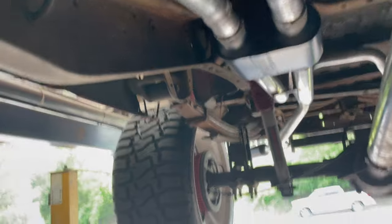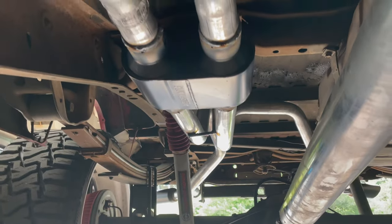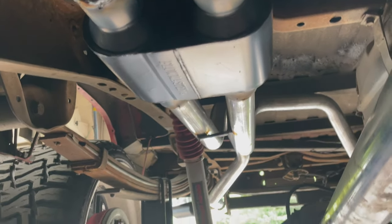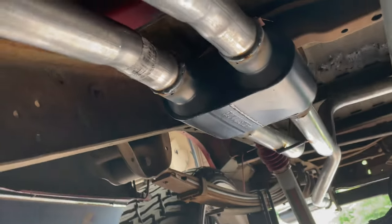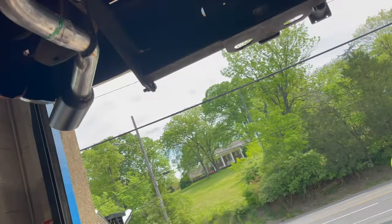It becomes true dual — already from the factory it comes into a single end dual out muffler. We cut that off and ran true duals with a Flowmaster Super 10, part number 8425154. There'll be a link in the description — it's a dual in, dual out, two and a half inch, then two and a quarter tailpipes out the back on each side, mandrel bent into the corners.